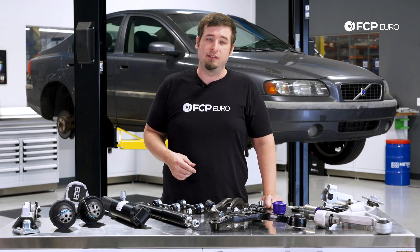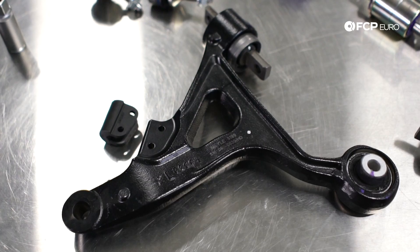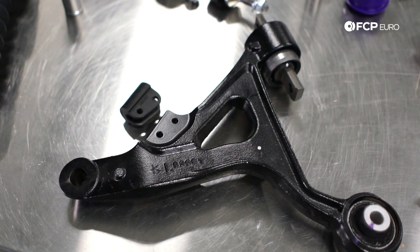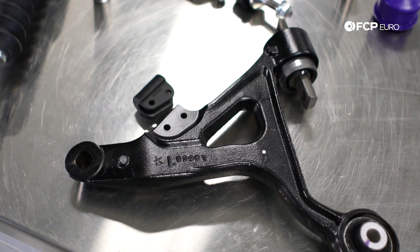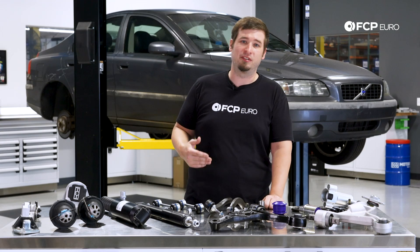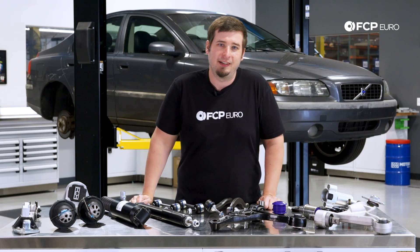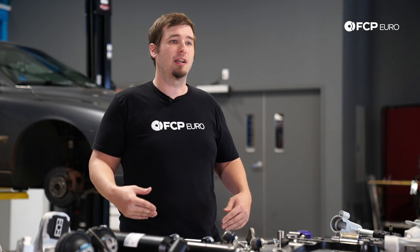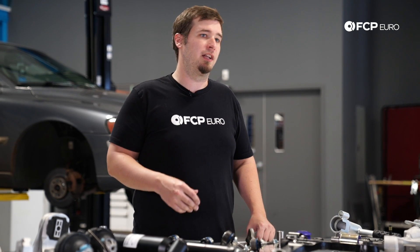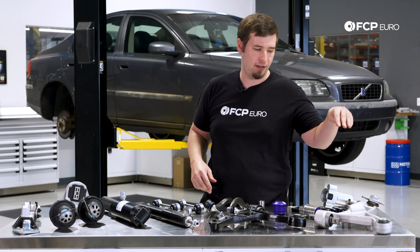One thing to note for P2 S60s and V70s is that somewhere halfway through 2007, they changed the control arm material from aluminum to steel. So if you have an '07, pay attention to the chassis number on the product listings — that's the last six digits of your VIN. They stopped the presses at chassis number 626502 and started installing the new control arms. The first thing many drivers will notice when taking a P2 car for a spin for the first time is the turning radius, which ranges from large for cars with smaller diameter wheels to comical for those with 17-inch wheels such as the R. The control arms have specific steering stops installed to limit the steering lock based on what wheel size is installed on the car, and I recommend getting new ones every single time they're replaced because they're usually shot.